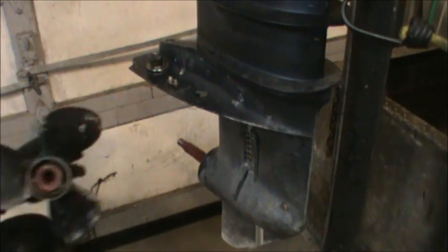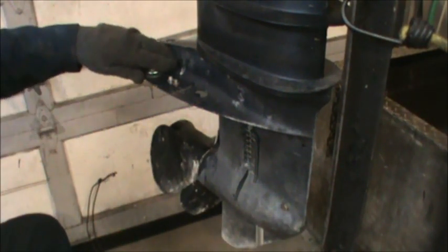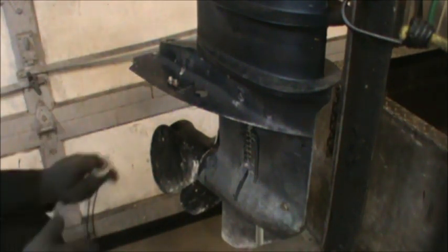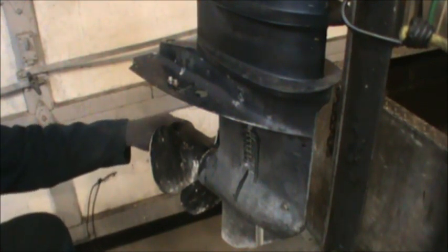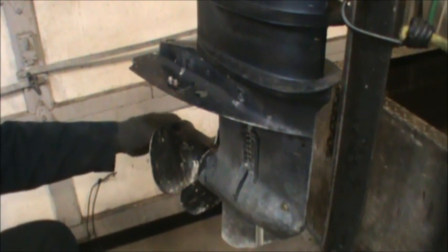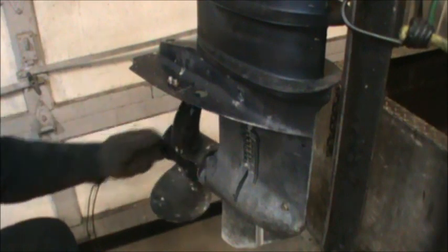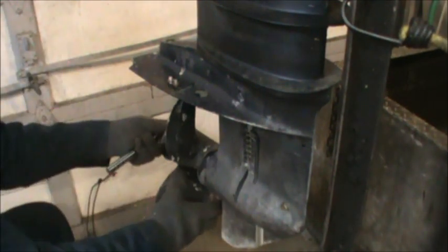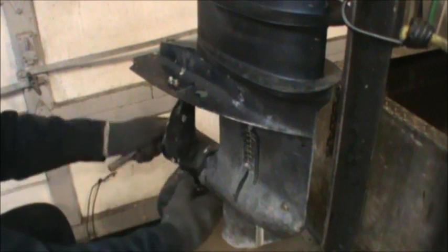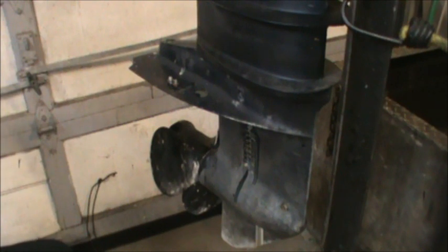Get the old propeller back on, take the washers and so forth back on. Let that lower unit oil drain for a bit and come back and fill her up. Just snug — that's all you need. So we've got that all greased up, we've got the lower unit oil draining. As we go up the engine, you can take your grease and there are places along the line that you should pay attention to.